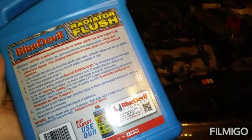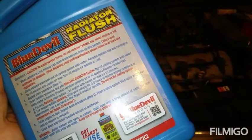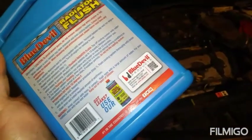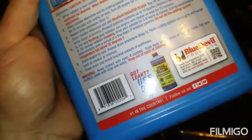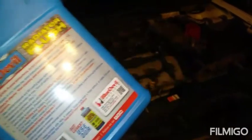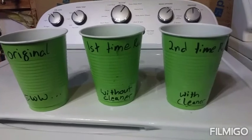In short, here's what we're going to do: first, drain all the coolant out, then put simply water in, let the engine warm up and run the heat on high for 10 minutes minimum. You can do this a second time before adding the mixture if you want it even cleaner. On the second go-around, run it for three to six hours under normal driving conditions, and do not let it drop below 32 degrees since you have no ethylene glycol in there. The third time, fill it with your 50/50 mix — half water, half ethylene glycol, the green stuff.